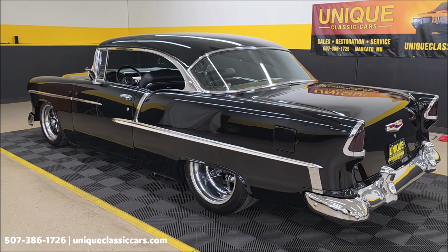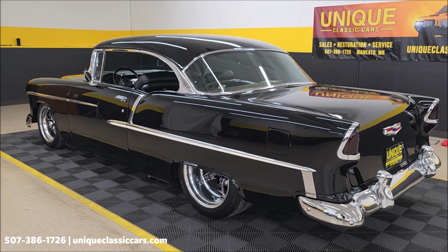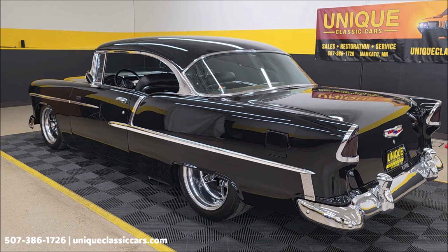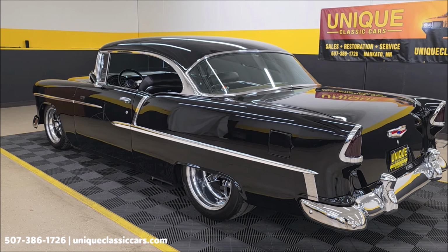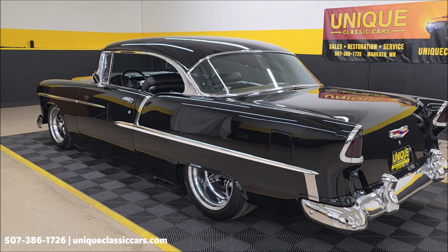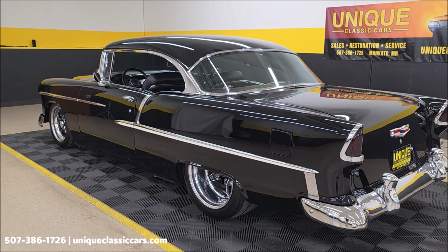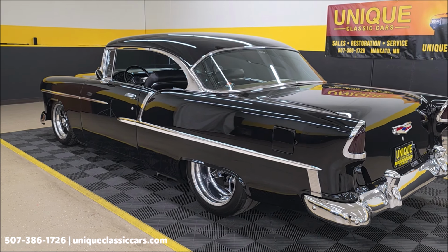Viking double adjustable Warrior shocks all around. 350-pound front springs, 175-pound rear springs. What's on the rear? Chris Alston's 36-inch Pro ladder bar setup with dual panhard bars. Custom rear suspension mounting with custom, we'd have to get to the next page on this one.